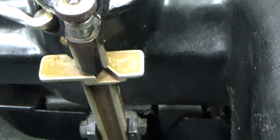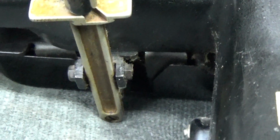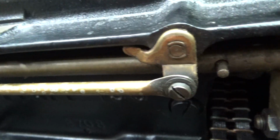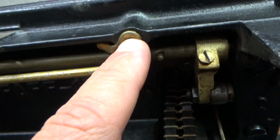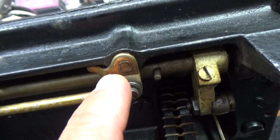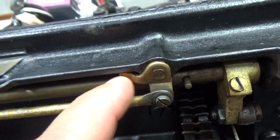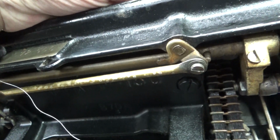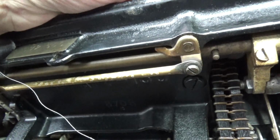This is part of the assembly that attaches for that embroidery unit, so that when you change the different controls, it actually responds. That might be helpful. So again, we're just looking at general varnishing, cleanliness, quite a bit there. This is going to be part of our feed dog drop assembly again. So this is definitely an area that is going to need some maintenance and attention.